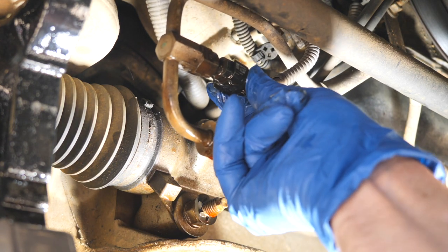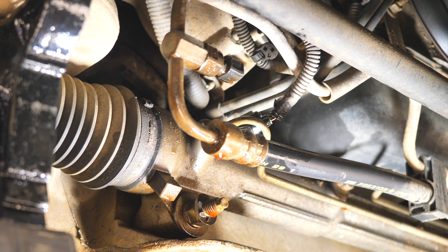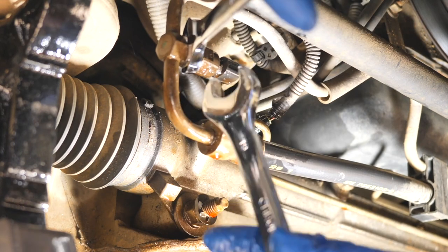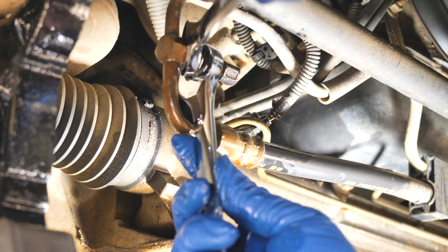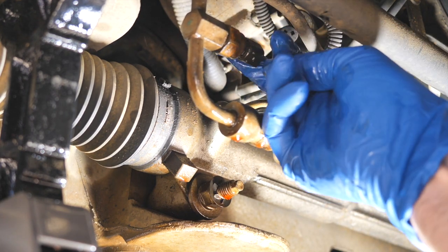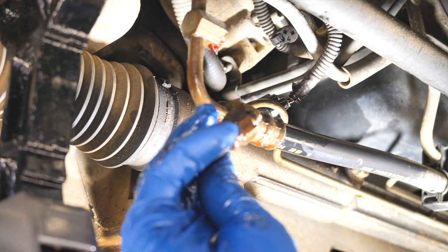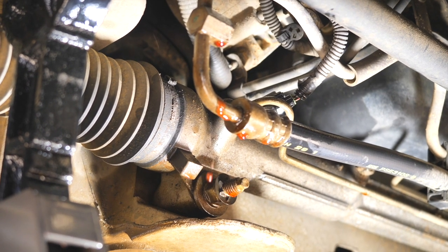You push your finger right here, take off the connector — push it and wiggle it — and it comes off. Get that out of the way, then we break this right here with our wrenches. It was an 18mm here and a 19mm here. I crack it loose and spin this bad boy off. There shouldn't be much fluid coming out since most of it already drained out on its own. Spin that guy off and there she is.